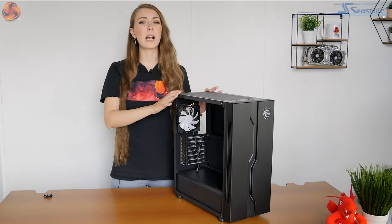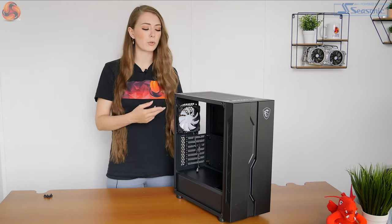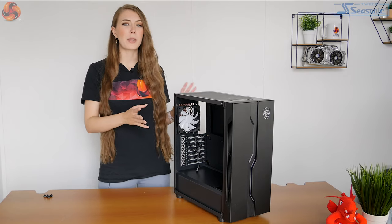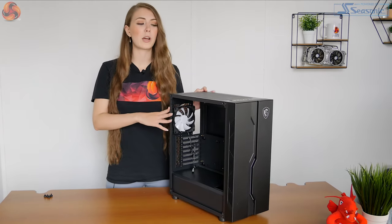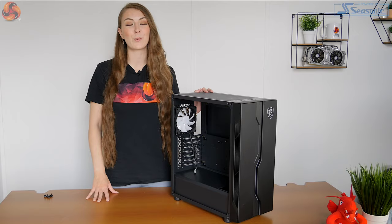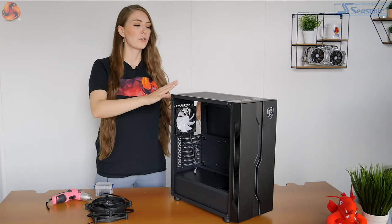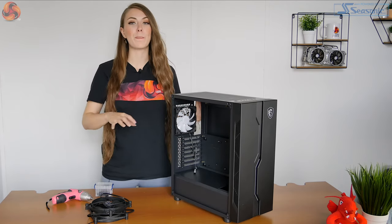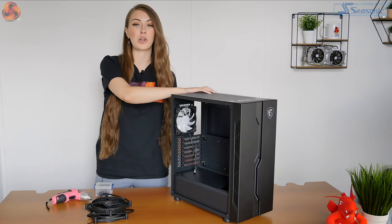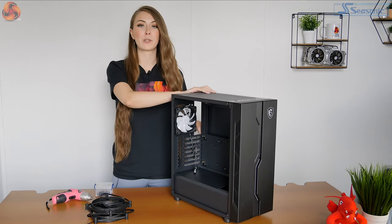In general, I can tell it's a bit more of a budget case. I'm slightly worried it doesn't have a front dust filter, and I'm not a huge fan of the snap-off PCIe brackets. But I think it's probably a decent-looking case. The first step in any case build is to get the case itself ready — I'm going to get all the side panels off, pull off the front panel, and then install a couple of Be Quiet fans, since this case only comes with the one RGB fan and the airflow won't be very good.